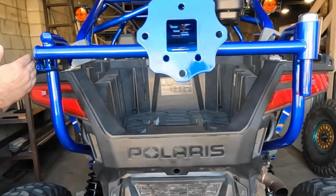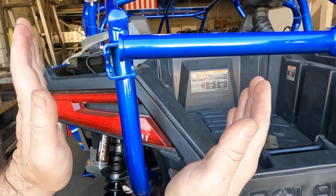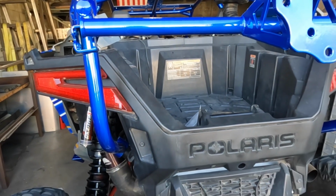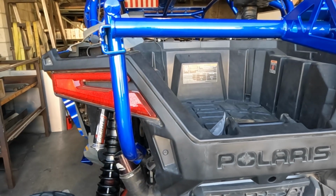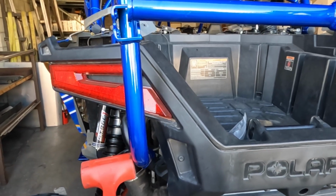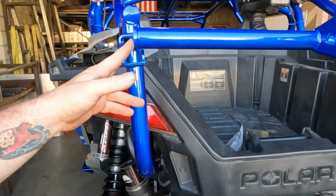And if you look over here as well, obviously these are substantially out of alignment. Because they're on a kind of skewed axis, kind of like this, you're going to have to adjust the left and the right individually until you get the center of your hub aligned with the center of your car. How we're going to do that is just take a dead blow, and you can hit right around here or a little bit lower down, and repeat on the opposite side as well until you get these two faces in plane with each other.